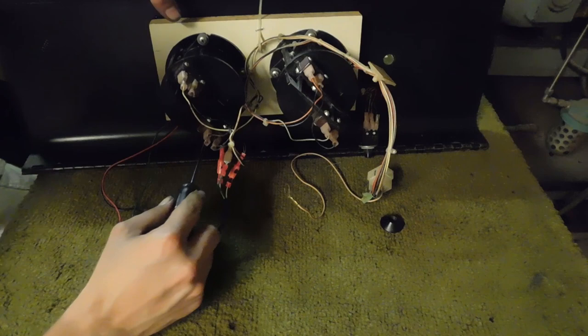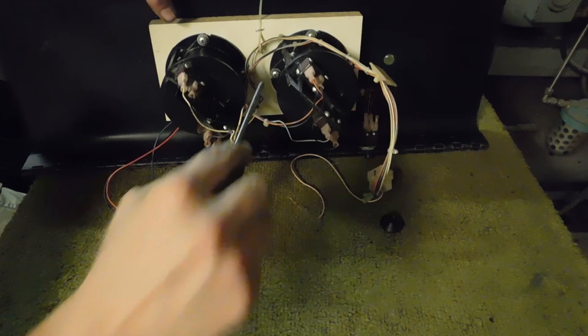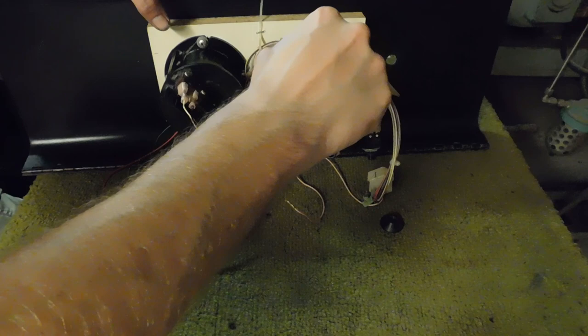Even if it's just your own game you're working on, or you're working on a game for somebody else, don't over-tighten these. Be very careful. Just get it to a point where you start feeling some good tension while you're threading them down. Once you feel that, go just a little bit farther, like, say, quarter turn, and you're there. You don't have to go any farther than that.